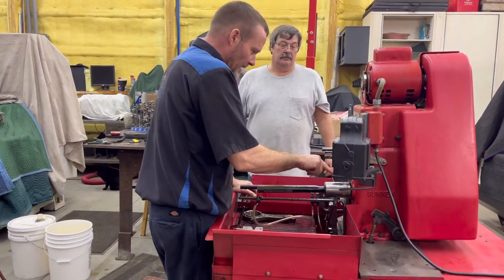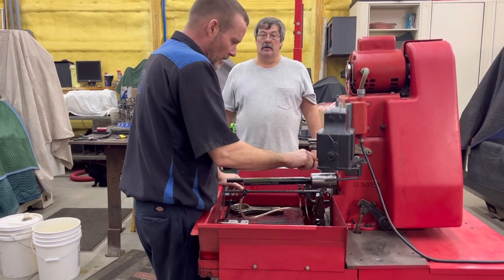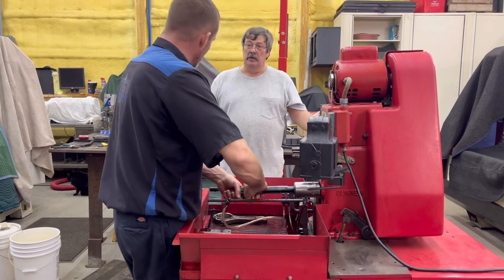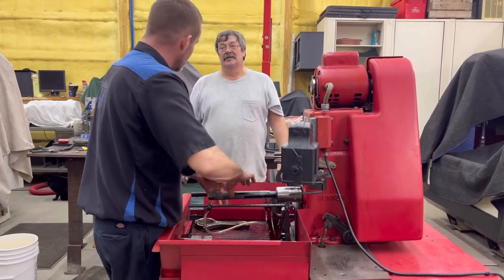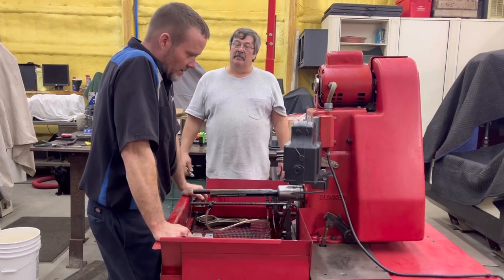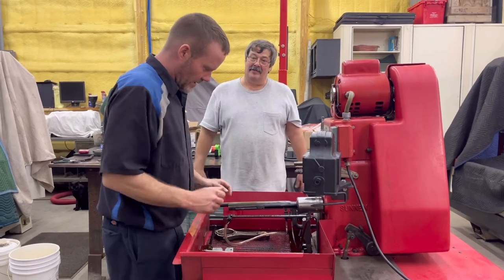And now when I set it, when I turn it and it goes up 1.5 something, as I hone, will it go back? It'll go back. Yes, because it's going to hone and it's going to break stones down. As it hones, the rod comes out further. Okay. Remember, you got a spring back there. It's always pushing. Starting to make some sense?